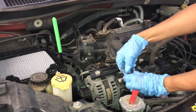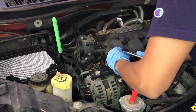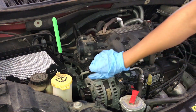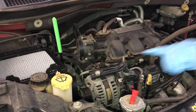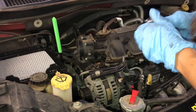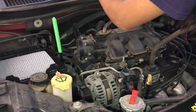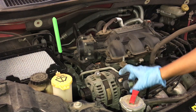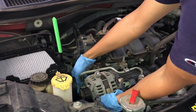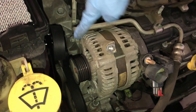This little lever right here — you just squeeze and pull. Now we're going to take this off. That was a 14 millimeter. This one I believe is a 13, and this one's a 13. So two more bolts need to be coming off. You got your electricals out and you got this holding bracket out. It's right here — this one and this one, those two — it should be about 14 millimeters, I believe as well.